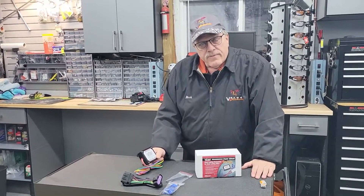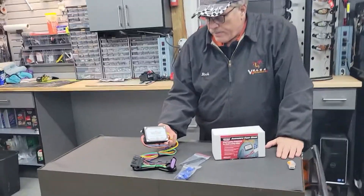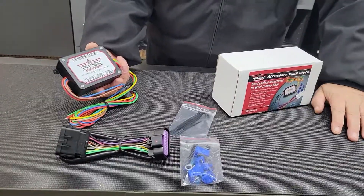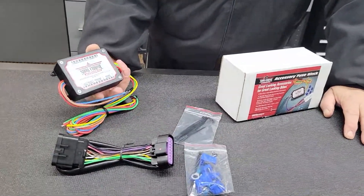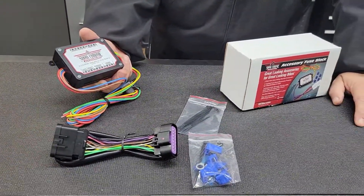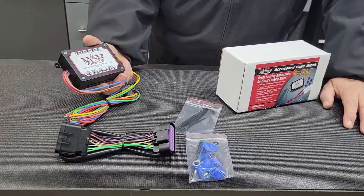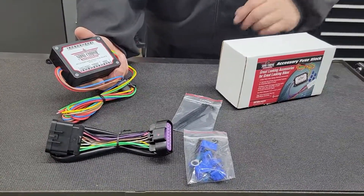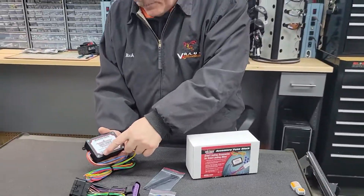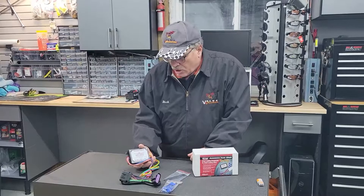There are several different brands available. We're going to show you the Big Bike Parts show chrome version right here. Basically what you'll do is take your power from the battery, it'll go into your box, and then you'll have inputs from your right turn, left turn, brake, running, ground — everything else into the box — that's going to trigger internal relays. Everything that comes through the contacts via the relays for all of your turn signals, running lights, and brakes will be supplied from your battery, which is being charged all the time.